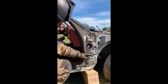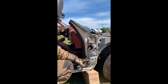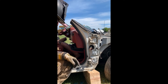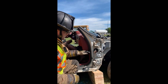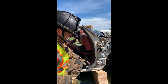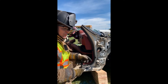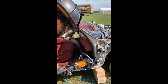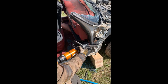Now we'll talk about jacking a dash — we roll a dash with the ram, we jack a dash with the spreaders. In jacking a dash, we're going to create a purchase point and bring the spreaders in to lift the whole dash up. Option one: cut down by the rocker panel, make a first cut there, second cut right above the hinge, then pinch with spreaders and peel it out to create a gap. Option two: first cut right above the hinge, next cut right above that, peel it out — but be aware that if spreaders aren't kept flat, the material may push out and down instead of the dash coming up. Cutting at the rocker panel takes a few more cuts but is more forgiving with a flat push surface.